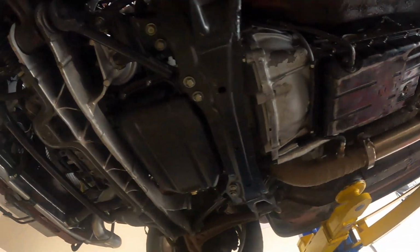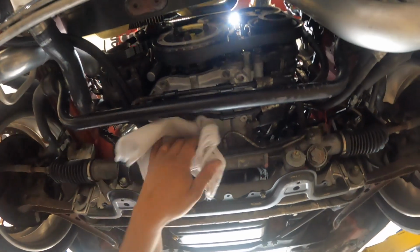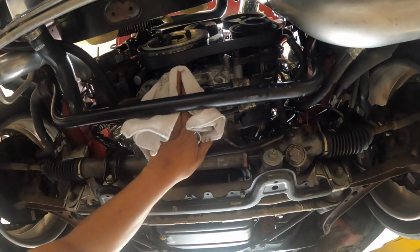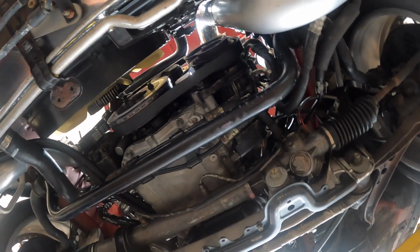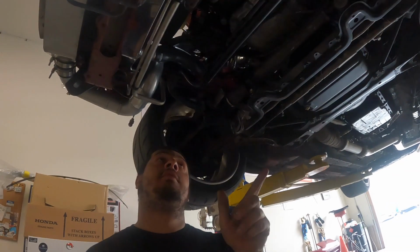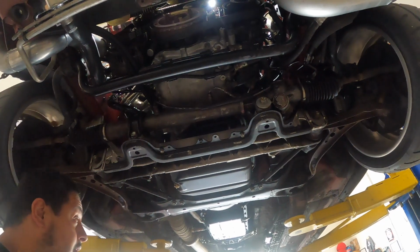Yeah, there's nothing on the ground, so I'm assuming that's just... Yeah. Now this wheel, on the other hand, doesn't look like that much, but it just started coming out at the end when you were... Ugh, yeah, the whole bottom of the engine. Front main seal. That's what you think it is, front main seal? I'm like 90% sure. Can you spot exactly where it's leaking from? I have to pull the balancer off and the front timing cover off, because of all the timing stuff. Oh, come on. Yep. I might as well. I'll do the pulleys, do that leak, this plastic shroud all in one shot because I literally have to take apart the whole front.